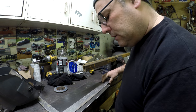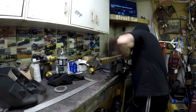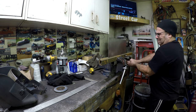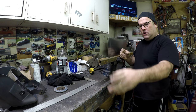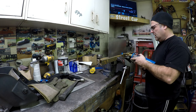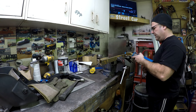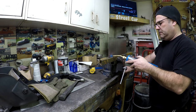I'll get the piece clamped in nice and tight. The metal is a little thicker than normal car sheet metal so it might be harder to bend. I came up with the idea of heating the metal a little bit — it's not an oxy-acetylene torch but it can't hurt to get it warm. With thinner sheet metal it would bend super easy, but I'm a little worried about this thicker stuff.